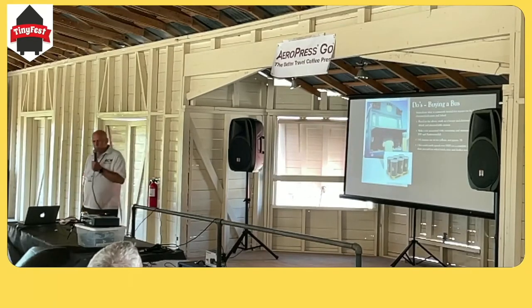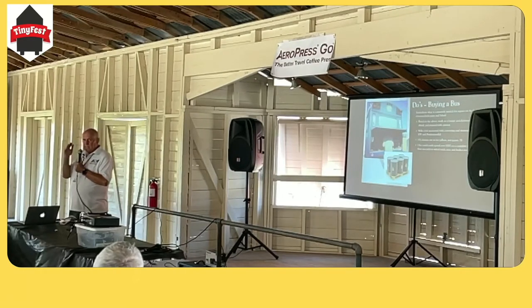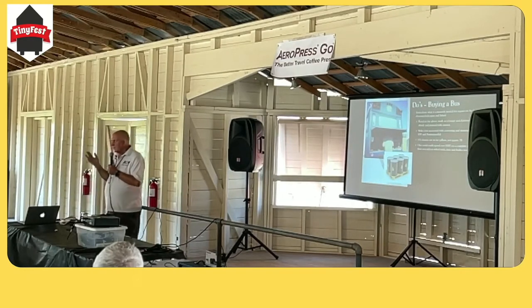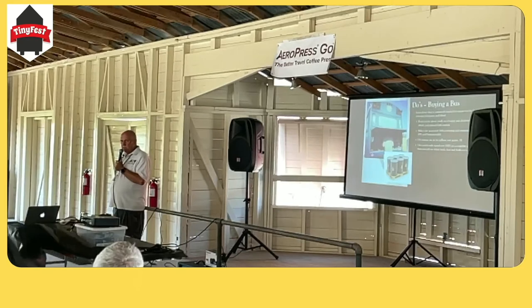Learn about the common types of buses that tend to wear out. Like an MCI bus or Prevost, they have airbags. After 20 years, you're probably going to have to repair their airbags, or replace them, I mean. It's not a hard job, but it's something you've got to do. If you can do the work yourself, that's fine. Airbags are $150 a piece, maybe. You can replace them all for $300 or $400, and you've got nice airbags.